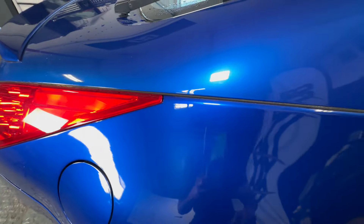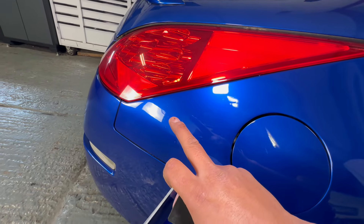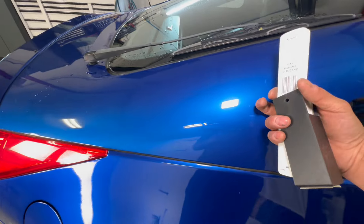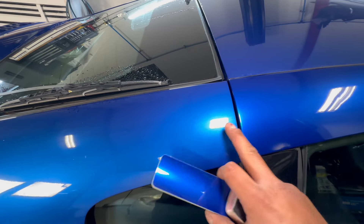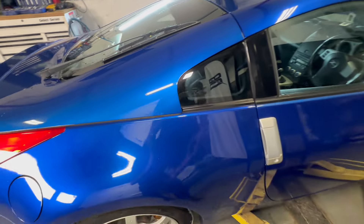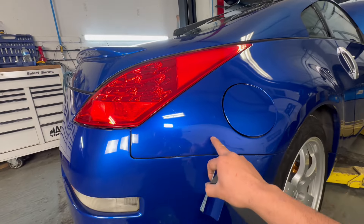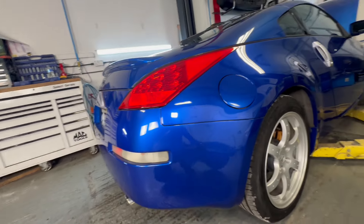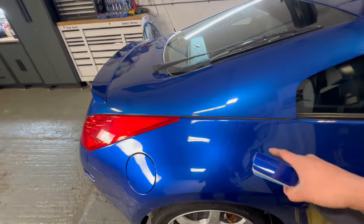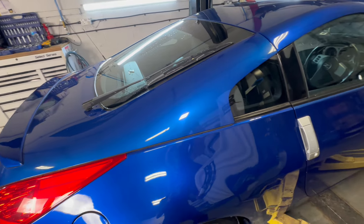It's not too bad - you can see this is a lighter blue compared to this panel. You can tell it's been painted before because there's a little bit of crazing in the paint where it's pulled back over time, but this area is faded. There's blue, light blue, and then the original color. It's a big problem people don't really see. I've got to quote to blend the bumper for the customer - explaining why we're blending the panel, because otherwise if the color is off you won't even look at the repair, you'll just complain about the color.